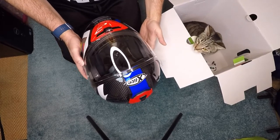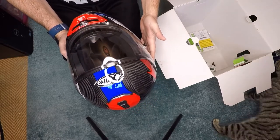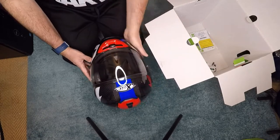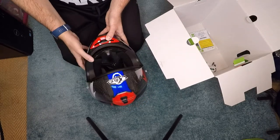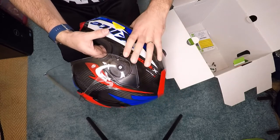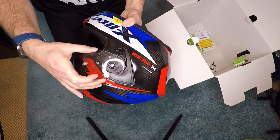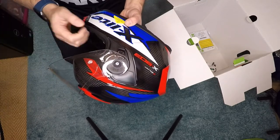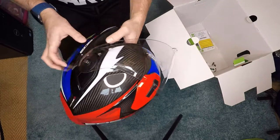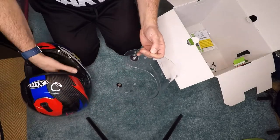Stickers are now off the visor. Next we need to take the visor off the helmet. One of the really good bits with this helmet is how easy it is to remove the visor to fit the pin lock. Open the helmet as wide as it can go, turn it to the side, and you have catches that are only visible when the helmet is at full extension — pin those and it lifts off. Quick flick and we're done. These are magnetic, so when putting it back on it just clips into place.